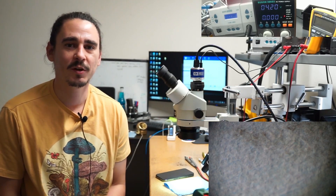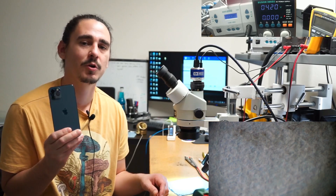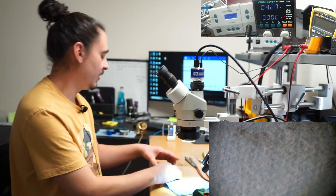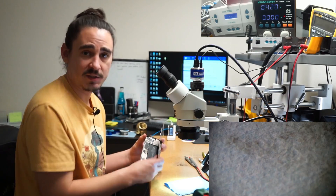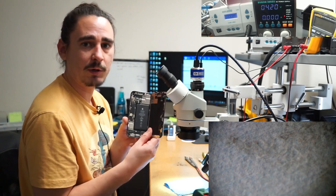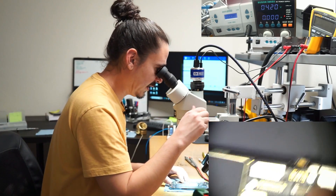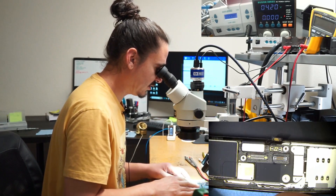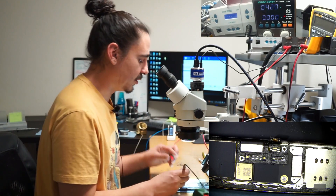Hello, this is Aaron with iBoard Repair and today I'm going to be showing you the live diagnosis and repair of an iPhone 12 Pro motherboard that's in here for data recovery. This customer stated that this phone just died spontaneously and they did nothing to it. I've already removed the screen and taken a look at the inner components and nothing's jumping out, but my first step when diagnosing these boards is to take my DC power supply probes and see what they're telling me when I tell the phone to boot.